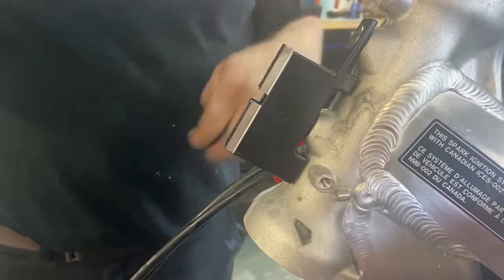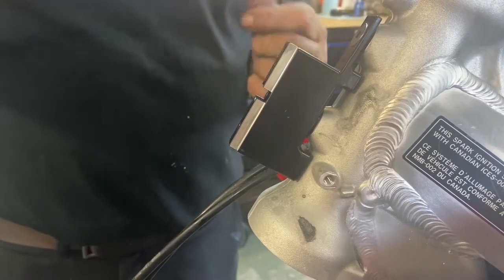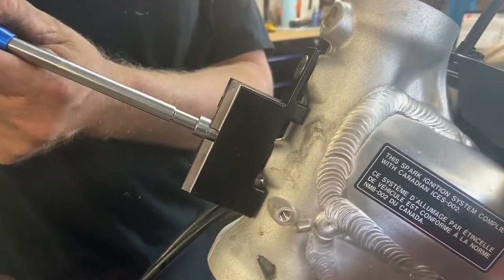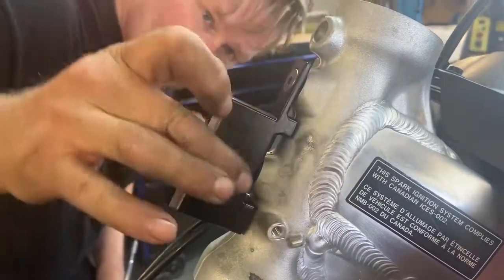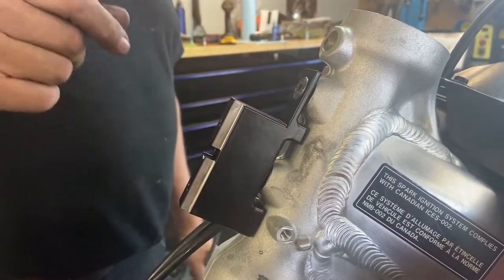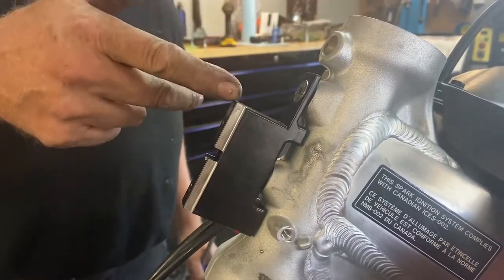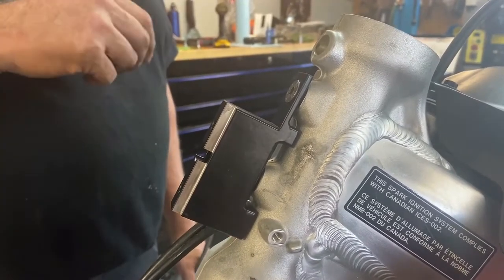The reason I have concern is I don't want this tab to bend. The reason they have this cutout is to have the ignition cylinder — where your key goes in — slide through there so you get full steering. The base is tightened and it's still not flush — there's still a hair of a gap. So what I think I'm going to do is actually unbolt this, put it in my mill and just get rid of the powder coat — it's going to have just a hair of a skin coat done.